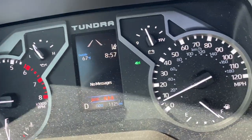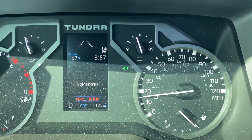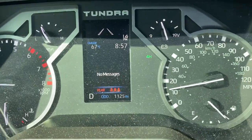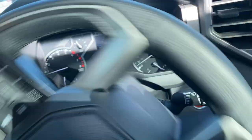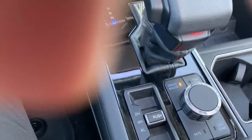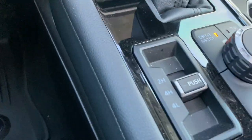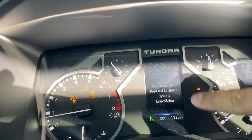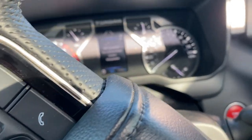Now let's say we're stuck or getting a lot of wheel slippage. A lot of these TRD Off-Road and TRD Pro models have multi-terrain select and crawl control — let's try it out. First, you have to be in four low. It is mandatory to be in the neutral position, then press it to go into four low. Right here it's going to show four low, and you're good to go.